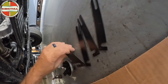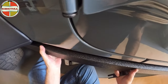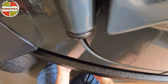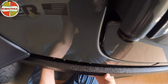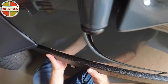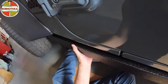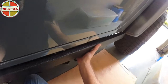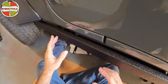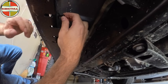These brackets are thicker and thinner. I think what I'm going to do is put a thicker spacer up here in the front — the way they work, you kind of slide the back over, and then the front part slides right up if there's enough space, which there is. That evens them up pretty well, and then once you tighten it up, it should pull them up so the spacing is pretty darn close. We're going to go ahead and do that, and we'll see how the spacing is. If I need to, I'll back them back out and remove the spacer — I'll just put one screw in the back and one in the front.